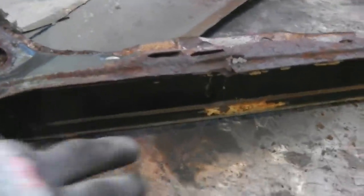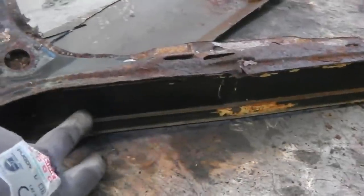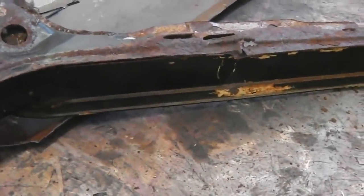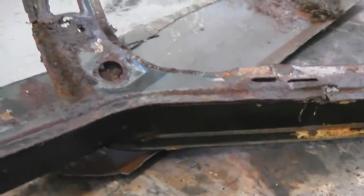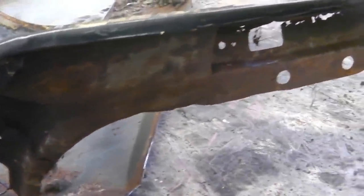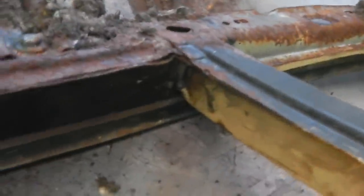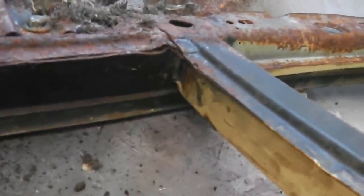So I will now start by wire wheeling this face, marking out those spot welds there, about 8 or 9, and then remember those two on the top around that area, there's two holding it on there. We'll get them. We should be able to separate off the A pillar or take out the gutter channel section as we need. We make the cut in the gutter channel section up there on the stagger join of that inner reinforcing plate, and that will then sandwich onto the car.